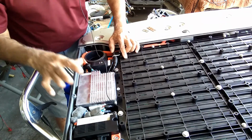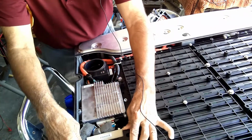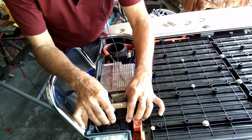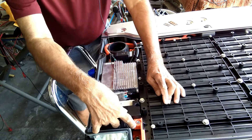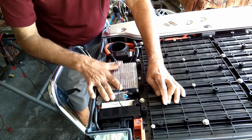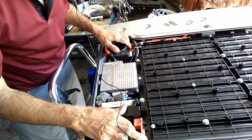So anyway, you have to remove and slide this out, and then after removing this, you go and remove the contactor assembly. For the contactor assembly, same way, you open all the nuts, and there's a little switch here. All that has to be removed, and then you have to push this out of the contactors, off from these posts. This also has two U-shaped contactors which go into these orange posts. So once you remove these three components, you will have the space open, and you will see the four posts, as I will show you more clearly in the next part.